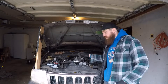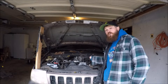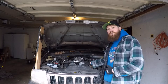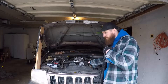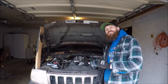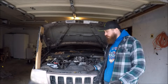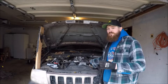Based on what everybody told me and what I think, this is probably a valve train issue. I want to start getting into this engine to diagnose what the problem could be, because apparently these 4.7 engines were pretty notorious for valve train issues — anything from spitting rocker arms to probably the most common issue, which is valve seat failure. If that valve seat fails, the valve can no longer properly seal, you're going to have no compression in that hole, and probably an audible knock because there will be metal things hitting each other that shouldn't be.